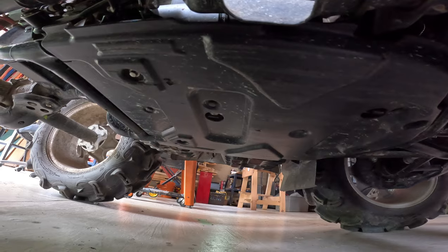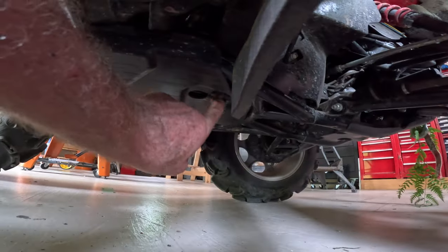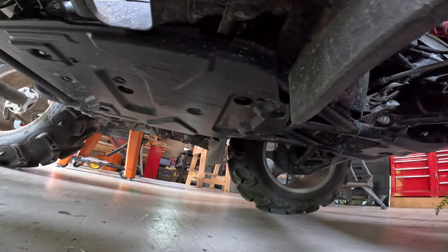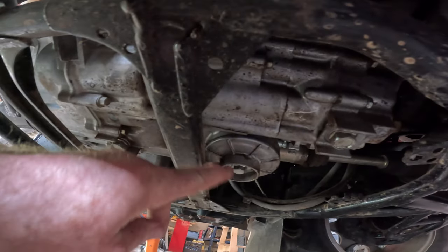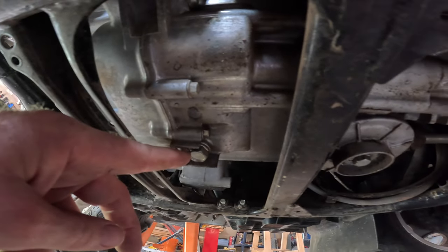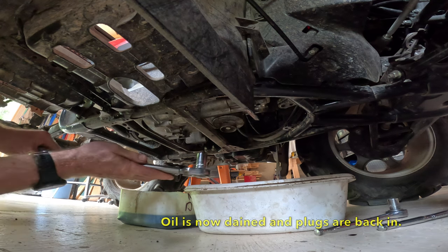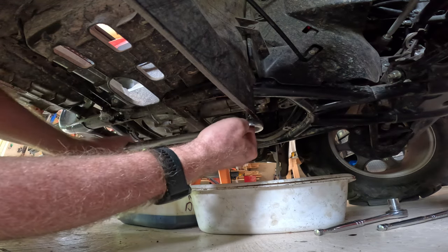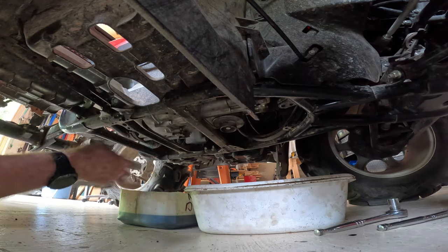There's the crash cover. According to the manual and my notes, I need an 8mm ratchet for these two bolts and a 12mm for these two, and then this plate will just drop out of the way. This has two drain bolts. Right here is the cover that the filter is in — there is drain bolt one, and back here is drain bolt two. Your manual will also give you torques on things. It's really easy to over-torque some of these bolts — that's just 18 foot-pounds on those two bolts. Try to guess at that and you have a chance of damaging something.